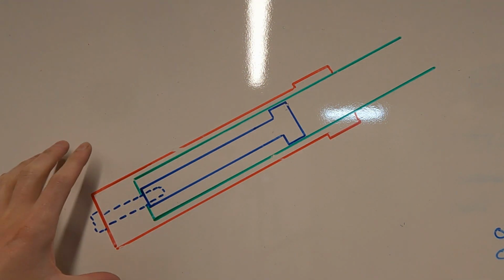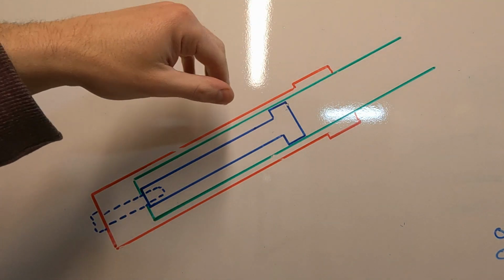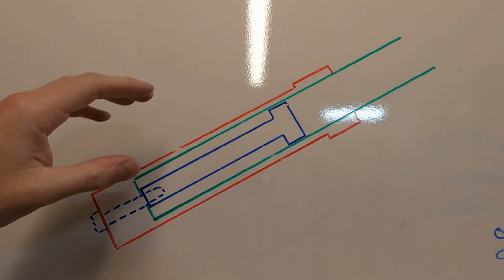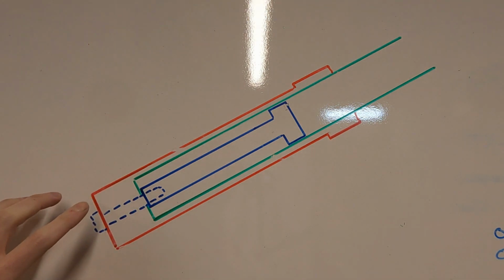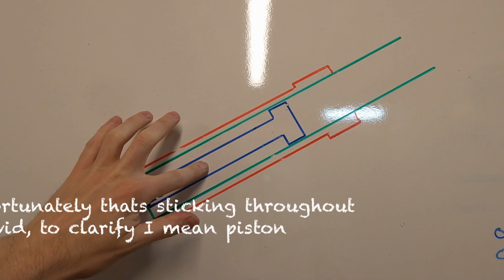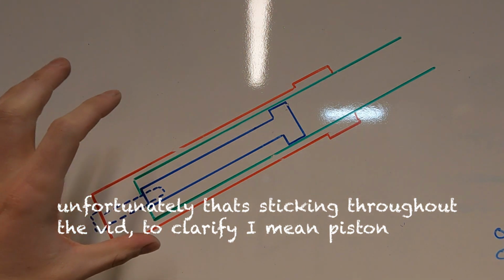Now I've done fork seals in the past, and basically all you do is take the cap off the tube, pull out the spring or what have you, and then undo this bolt here, and everything usually slides out. This system is slightly different because when I undid this bolt, the fork tube holder just spun in the bore. So you needed something to fix it in place.